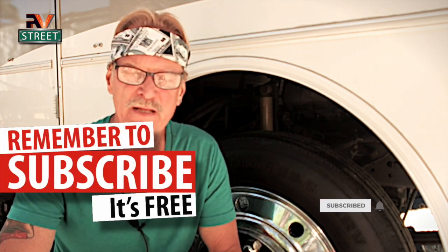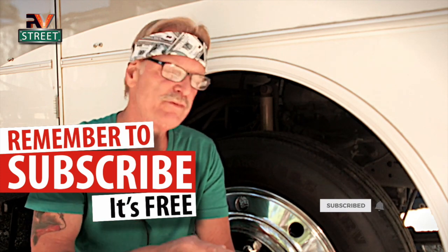After we paid, Joanie and I jumped in the coach and went up north on 45 to the light duty heavy duty truck tire company I use all the time - they do all my inspections and I buy my tires from them. I told them I needed the lug nuts re-torqued to 450 pounds since I just had some wheel work and both tires were removed. No problem - they re-torqued them at 450. Remember guys, anytime you dismount a tire or rim for any reason and all those lugs come off and get put back on, drive it about 50 to 75 miles and then take it to a shop and have them re-torque again. It's important to do.